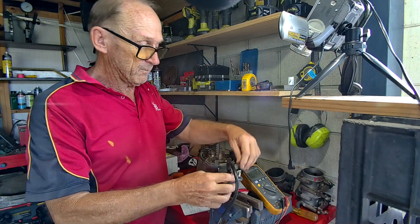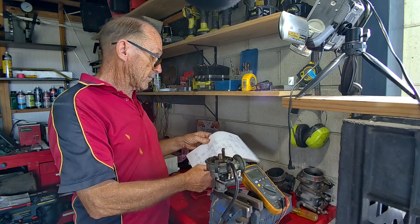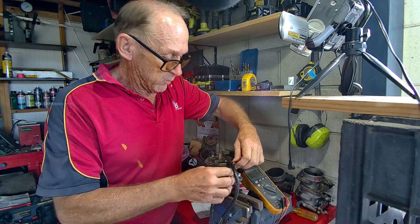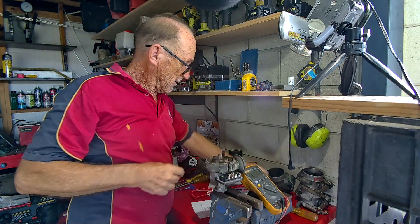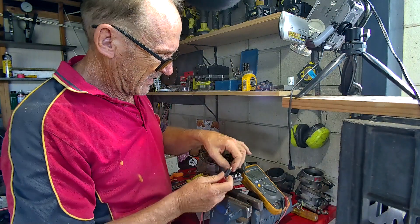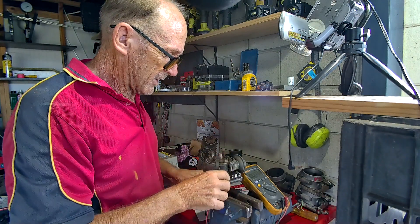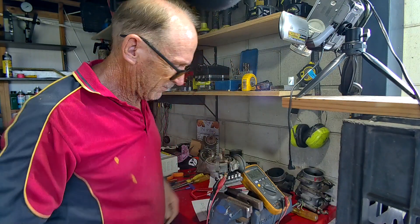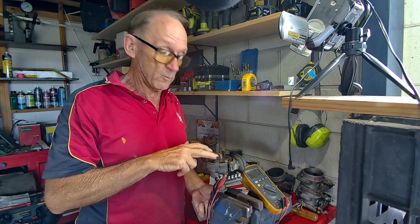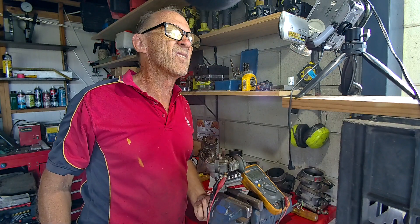If we haven't got a pulse down at the module, the flowchart says to test the pickup coil. We remove all the wires, take the low tension lead back off, set these two wires aside and put a voltmeter on them. This is a pulse generator so it's going to output a voltage. Make sure nothing is touching metal - if it's still in the car you'll be cranking the motor over.